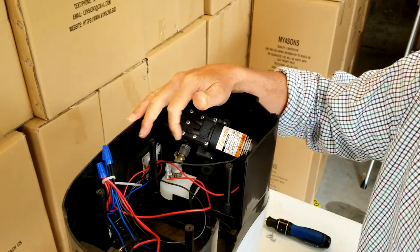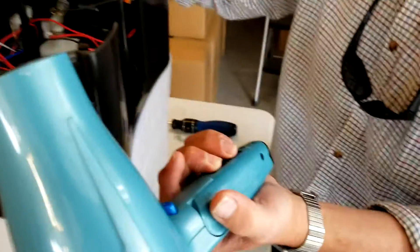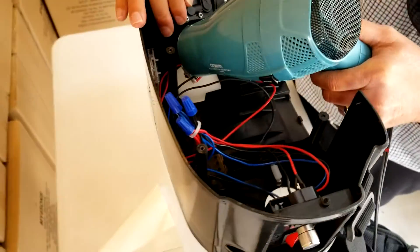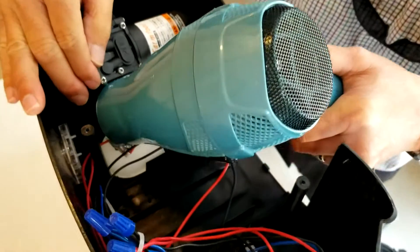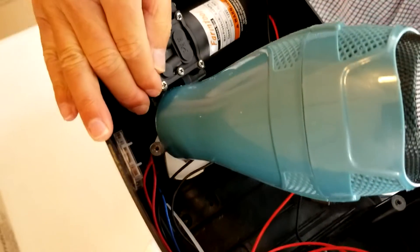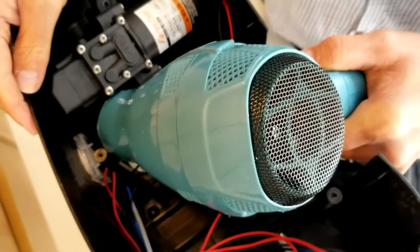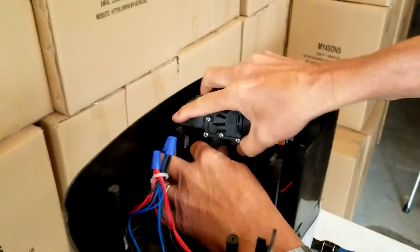We just showed how it can be a little bit challenging to get that pulled out after the elbow is removed. So what we're going to show is how to use a heat gun to heat up that portion of the elbow so it comes out very easily. Get the heat gun as close as you can — you don't want to leave it there too long, just a couple more seconds. And there we go — much easier.